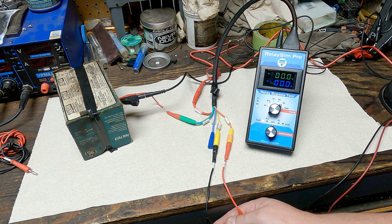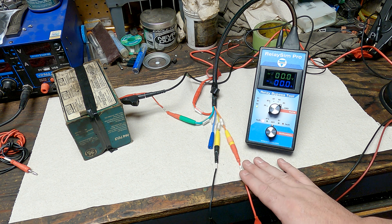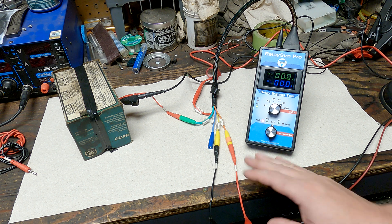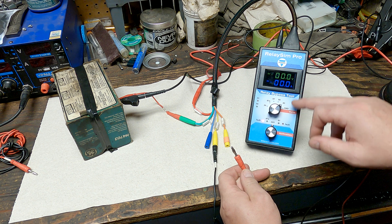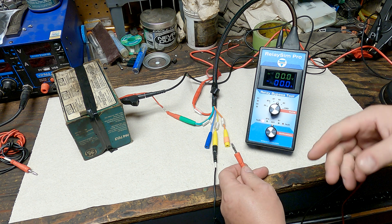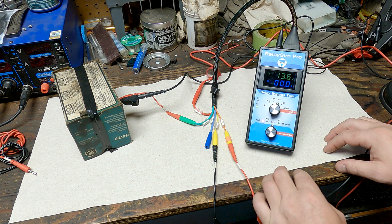You may get tricked in a very unique condition like that. I'd suggest testing with an appropriate test light after verifying the current it takes to cycle that relay on the control side. That said, let's move on — we're going to remove the feed from pin 86. The light goes off, and now I have zero volts on both 85 and 86, meaning I need to go find my missing feed voltage or confirm the control is being commanded on.